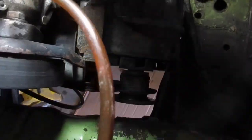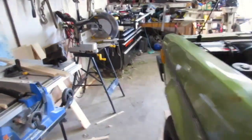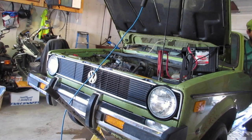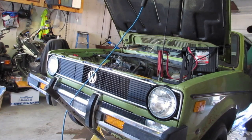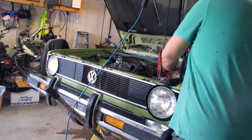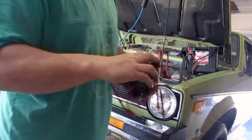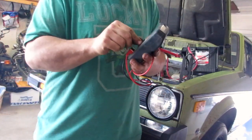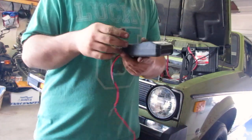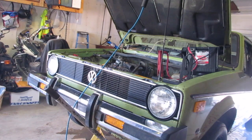This is the bolt I broke — this top one. I got the alternator all installed. I'm going to start her up and make sure there's nothing going on. This alternator is charging 12.23 volts, so by my experience, at least in the North American world, that's not enough. Tuesday my new alternator shows up and all should be well.